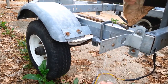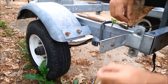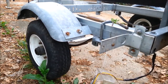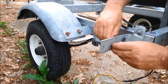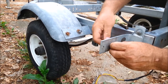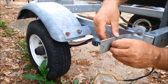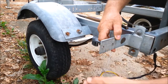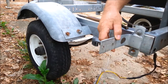Here's the piece of plastic that broke out. Don't want to lose our fasteners. I have a rag here I'm going to put on the ground to lay my pieces in so they don't get lost amongst the leaf litter. I got that loose, and these are carriage bolts — they have a square head underneath. That's the kind of bolt you can work with where you don't need a fastener for the other side if you have a square hole or a recess. You can see the square head under the round. That's called a carriage bolt.